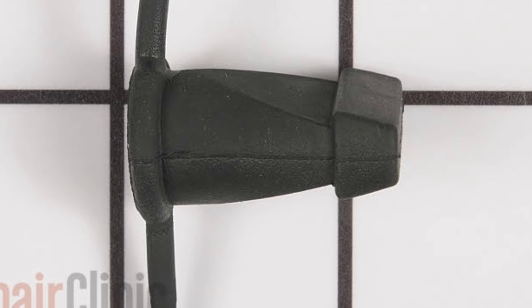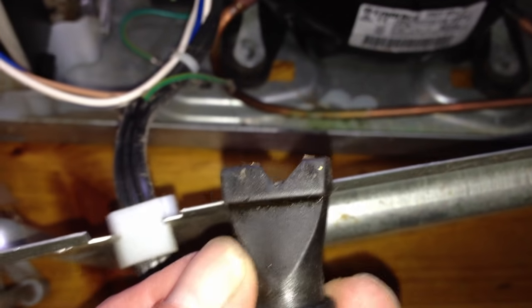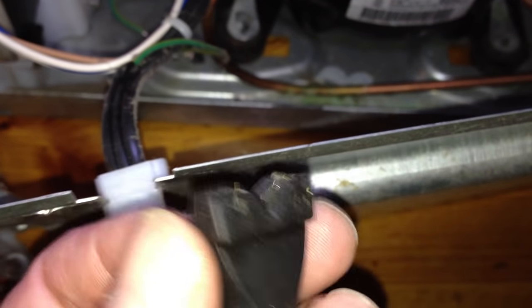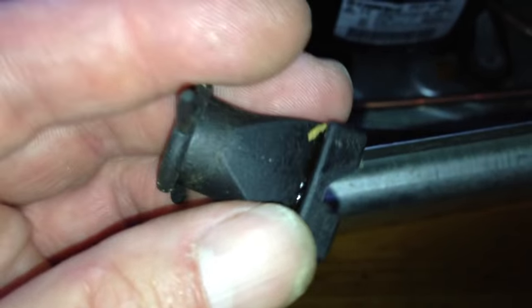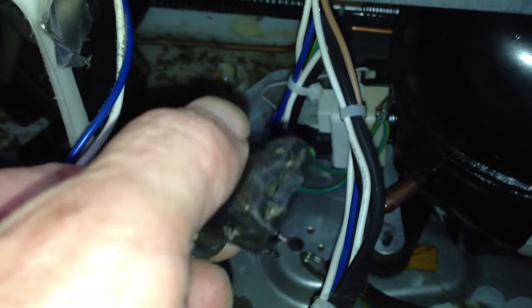So there's a workaround method I'm going to show you. Here's the cleaned-up check valve — this stuff is really greasy in there, and I ran the steamer through it. To help prevent this in the future, I just put a little notch in the opening end of it that will help keep it open. You don't want to just eliminate this entirely, because the purpose of this check valve is to keep humidity from the air and from the evaporating condensate pan from getting up into the freezer compartment and causing excessive frost.